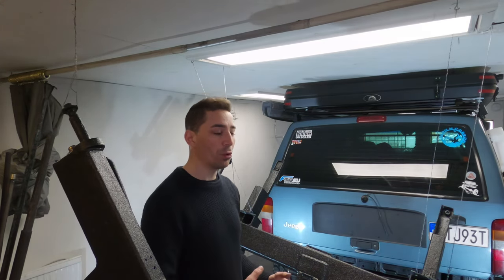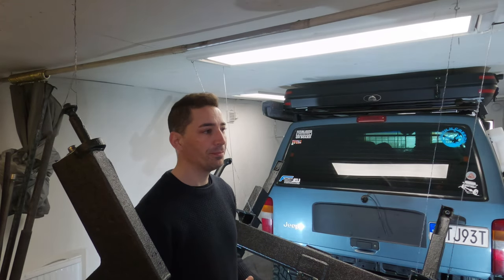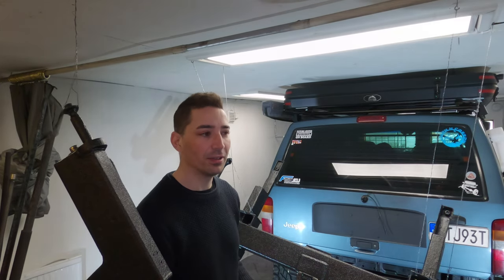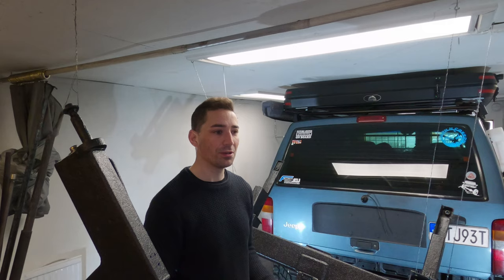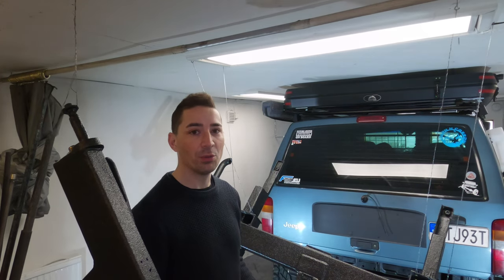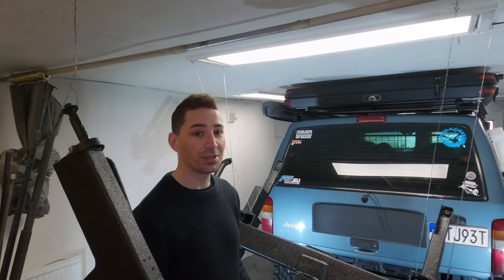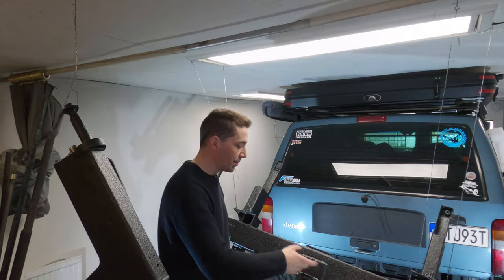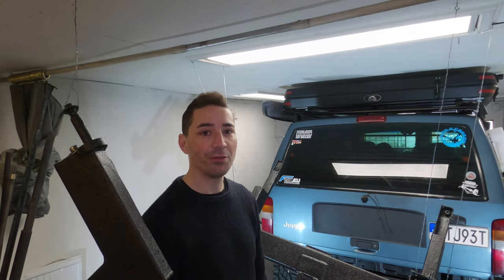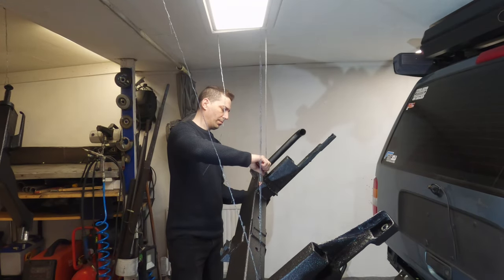If you walk the gun too far back on the final coats and dust off the Raptor Liner to give it that really matted look, you'll create a very matted surface, and naturally there are more pits and crevices for the dirt to get into, and it's harder to clean. Whereas like this, you can just wash it down with soap and all the mud will come off it. So I'd always recommend that. But let's put the bumper on.